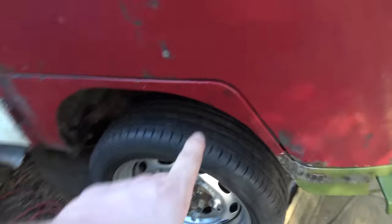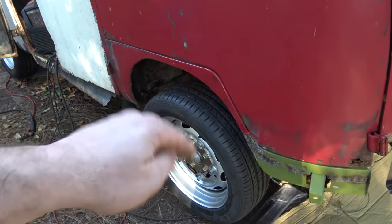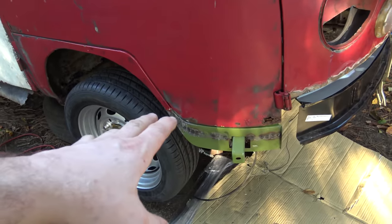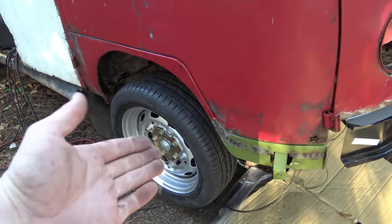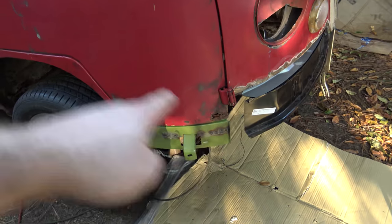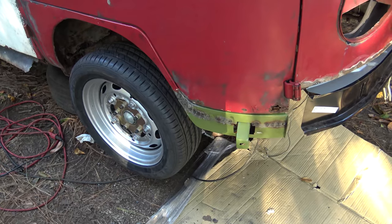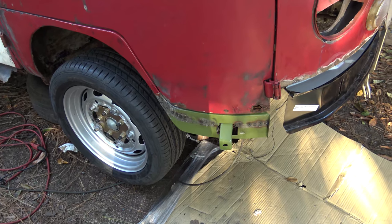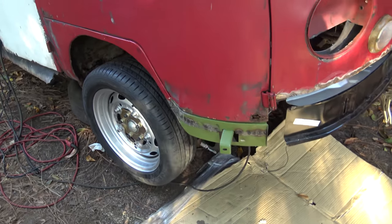And what happened is the seat pedestal, and that's this area that's on top of the dog leg, is bent down a little bit because it had no structure supporting it in the front. So I'll put a floor jack under it and lift it up before I weld it in the front, so that way my door gap is nice and even the whole way along. But that's what's going on there, and it looks like it's going to work out pretty good. I've got a little bit of patching and welding still that I need to do.